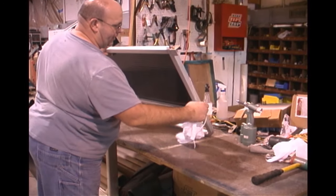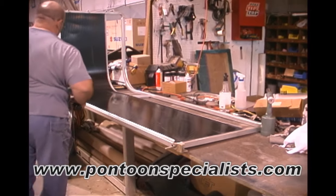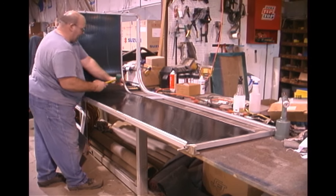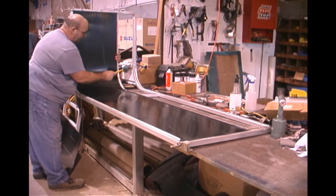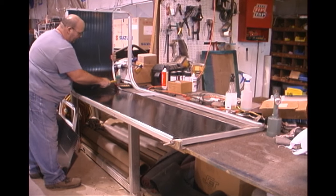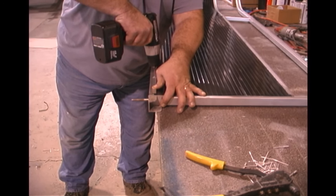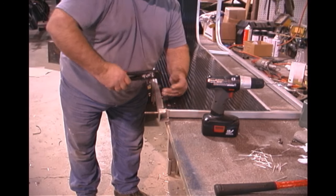Now that your new piece of skin is in place you can remove your rags. Begin pounding the lip back in place with a rubber hammer or by using a carpeted block of wood. Start in the corner and keep an eye on all your edges so that they stay aligned. If the lips to your metal broke at any point, you can simply drill through the lip, skin, and rail and use a rivet to attach it into its original position.